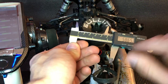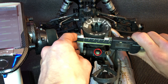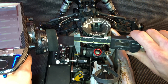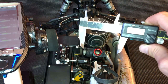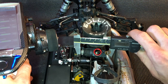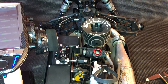Now how this measurement can translate to other engines: we're going to zero the calipers on a closed carburetor, and then open it up and see where we're at. You can see it's about 4.88mm. So that's a measurement you can do on any carburetor, and that range is probably going to be between about 4.75 and 5.25mm — somewhere in there is where you're going to want to be on any engine.